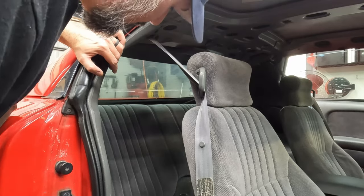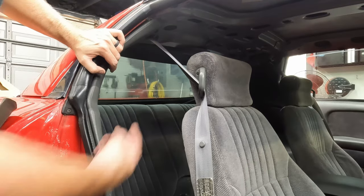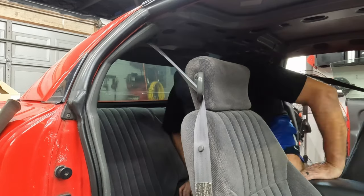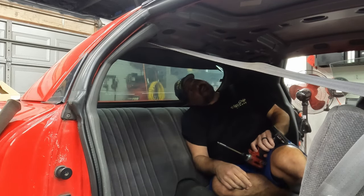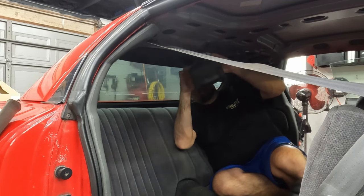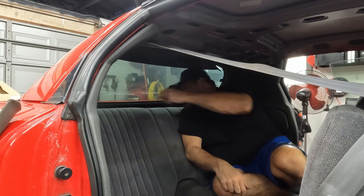Let's head inside the car. First thing I'm going to do is try to squeeze into the back seat here and get that dome light down. It's just held up by Phillips head screws. Just so I don't break anything, there's a little clip on the back — I'm going to pull that clip out and take the dome light all the way out. We'll set it up there for now.